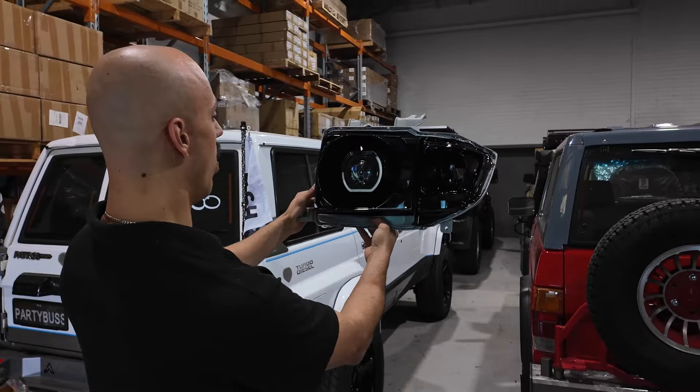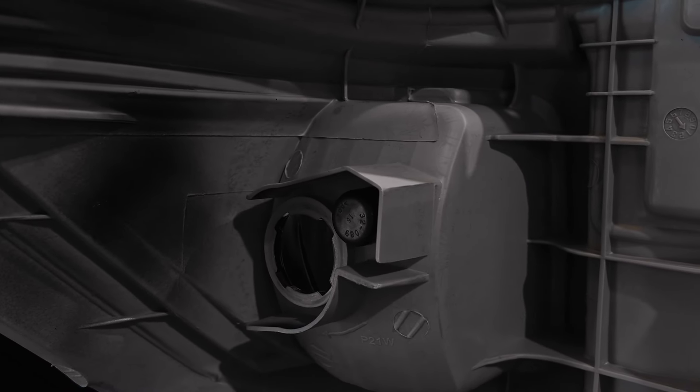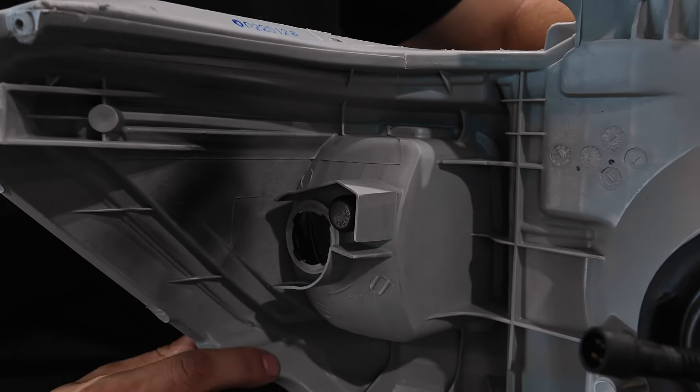To gain a bit more depth for the rubber boot, trim the little ring off, then feed the cables through and push the boot onto the back of the light. This hole can be left open to let the headlight breathe, or siliconed up if you're prone to wet weather and moisture. Most headlights have factory breathers, like the black one here, so we're going to go ahead and silicon this one up.